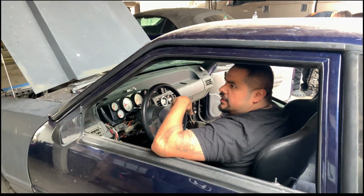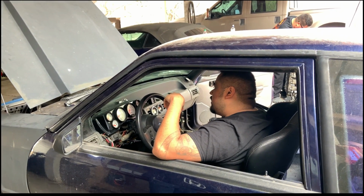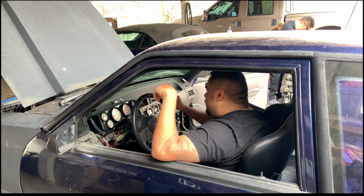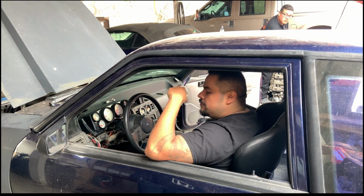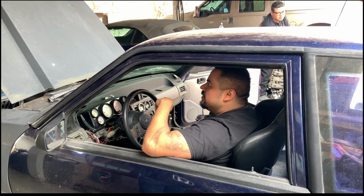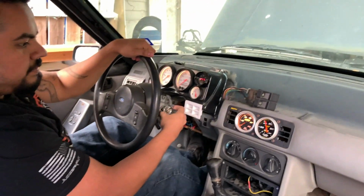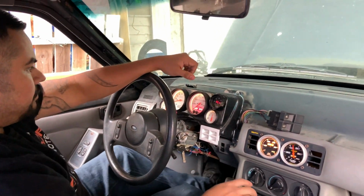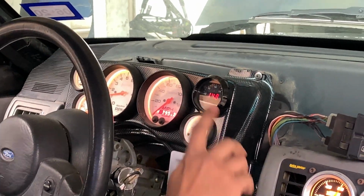It looks a lot better. And then we'll go through the RPM, see how the fueling looks at a certain RPM, and we'll go from there. Then we'll take it out for a spin. You can drive it while I monitor everything else. And then we'll see what's up. We won't go right up the throttle just yet because it's a fresh build. We don't want the heads to lift and boost to go into the water jacket, stuff like that, because we've had that happen. So I really don't recommend it. I want to let this stabilize.